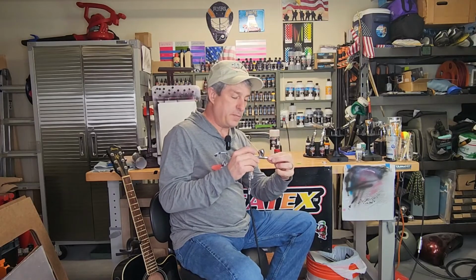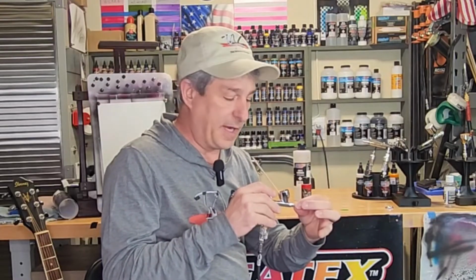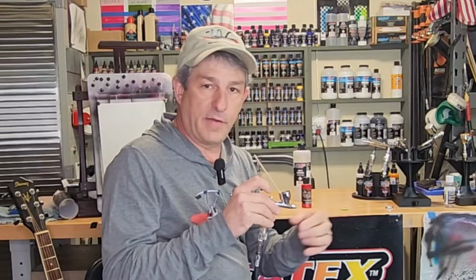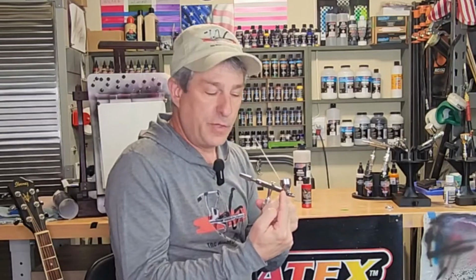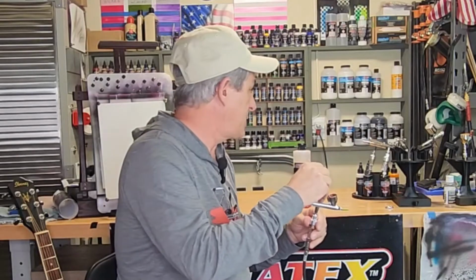The other thing I like to do is I like to take my fingers, pinch it over the ends. I know there are some people out there say they wouldn't recommend it. I've been doing it since the beginning. It works for me. And I like to give it a little bit of a backwash because you have the reducer sitting up here in the gun. You drop the paint in. I mix it up, but I can't mix what's down in here. So I want to run it back through and give it a little internal mix.